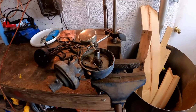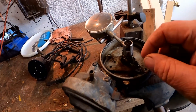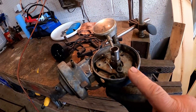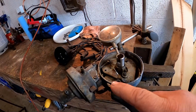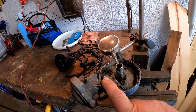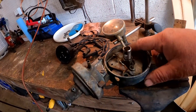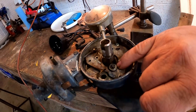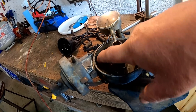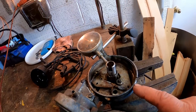What I found was there was some issue in here — whether it was grounding out — and the points weren't giving consistent spark. I did go get another distributor, and I knew right away when setting it up that the new one definitely had a much healthier spark. Something in the old one was shorting or grounding out. I think there's a little isolator — plastic or fiber washers — that isolate the plate. Anyway, the new one sparked great and I knew it would fire up, and sure enough it did.